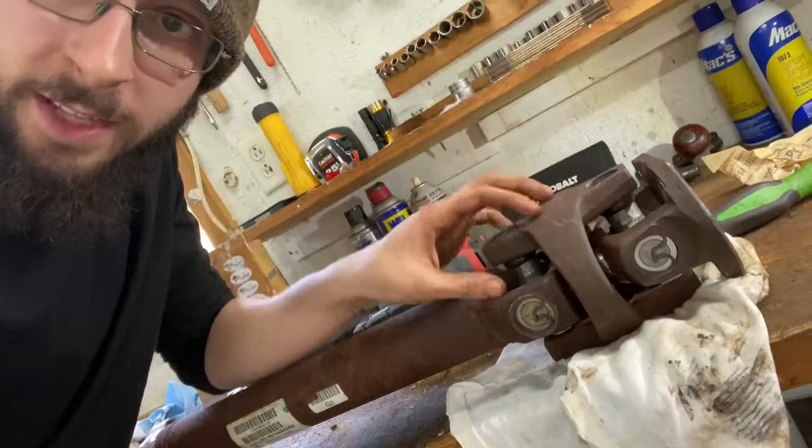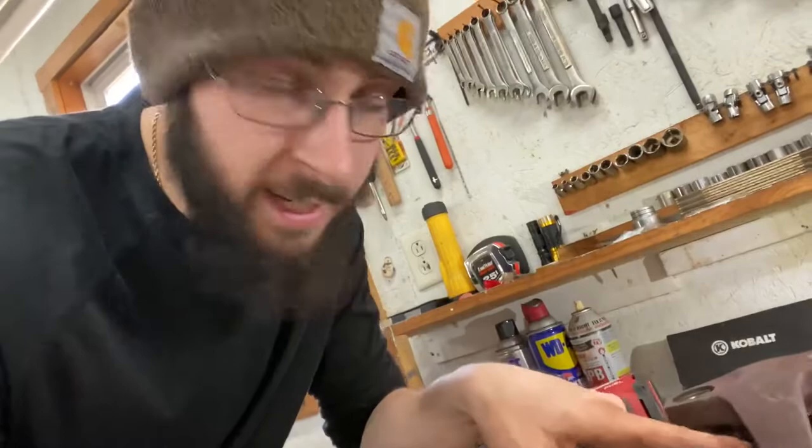And then there's a little ball, kind of like a ball joint, inside there, and it has needle bearings in it. When you pull it out, because of the suction, it sticks to the center. There's a pin in the center with a spring in it, and the needle bearings were sticking to it. When you went to put it back on, it wasn't letting them go back in. So I had to reseat all the needle bearings that had come out, which were about 8 of them. And then I had to take it apart and put it back in multiple times because it wasn't wanting to go all the way on.